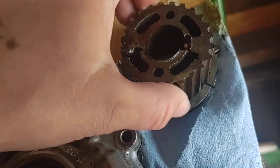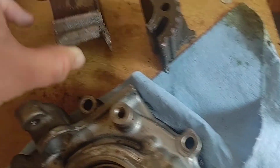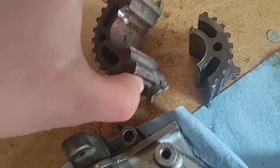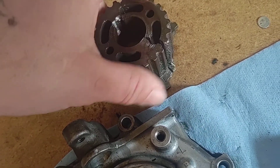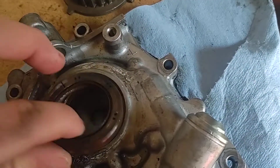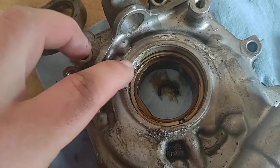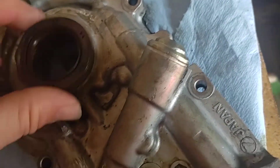What I've been dealing with — as you saw in one of my previous videos — is a crank sprocket that basically welded itself to the crankshaft from a bad shear key install done by someone else. It took some work to get it off; I had to cut it off, and doing so damaged part of the oil pump. So we're doing an oil pump replacement.